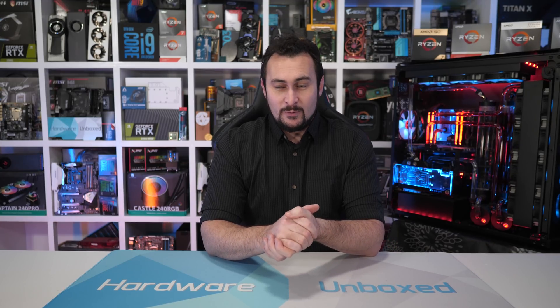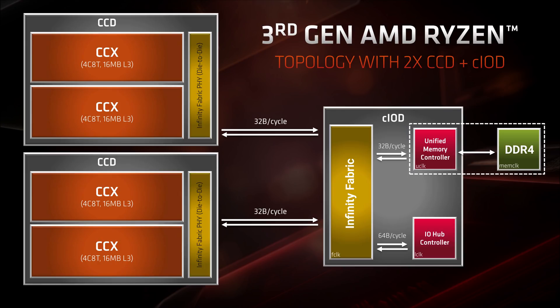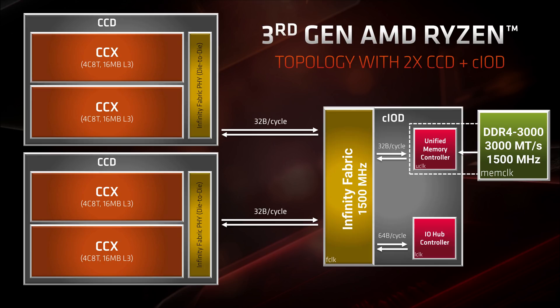That's what I spent almost a week doing — hope you found the results interesting. Before wrapping up I want to discuss the FCLK, which is the clock frequency for the Infinity Fabric. By default it operates at the memory frequency, which is half the data rate — so DDR4-3000 runs at 1500 megahertz. It's often referred to as 3000 megahertz memory but that's actually wrong — it's 3000 mega transfers, which is the data rate.